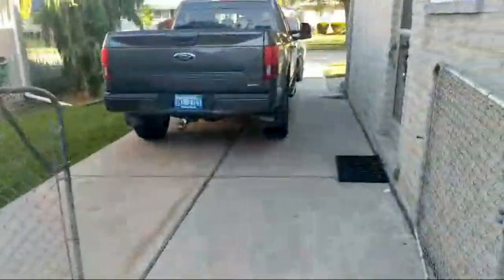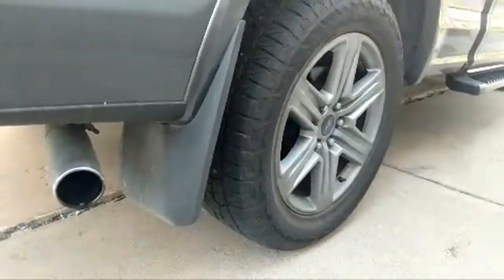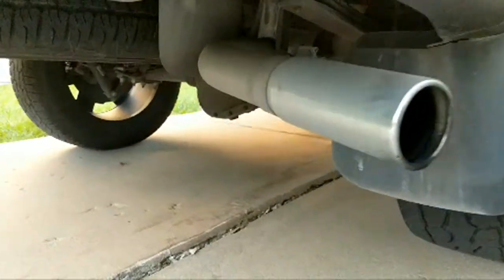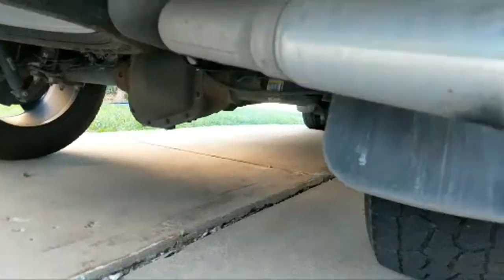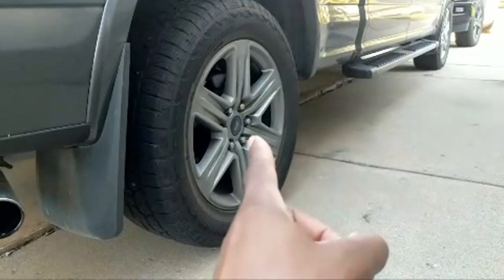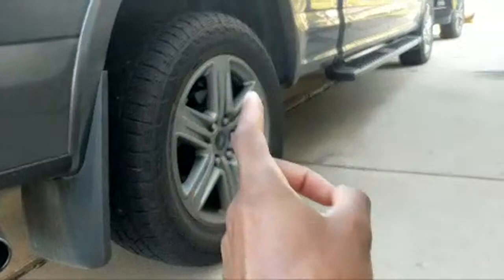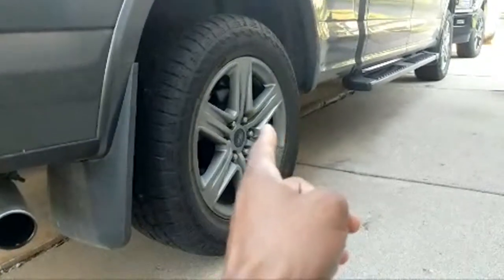So basically, the difference, and what I'm trying to say is, the bearings in this light duty rear end are actually riding on the axle shaft itself. So the shaft goes into the differential housing, and it has a little C-clip that holds the shaft into the vehicle. And then the bearings that are in the end of the axle housing are actually contacting the axle and riding on the axle, so essentially the axle carries the load of the vehicle and it provides the torque. So it twists and the bearing rides on the axle and carries the load.